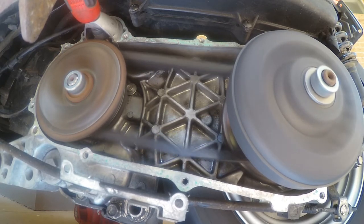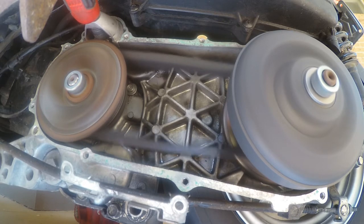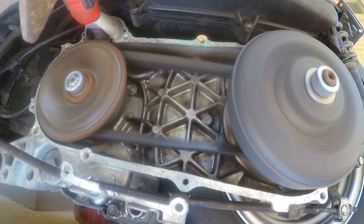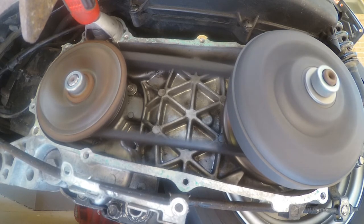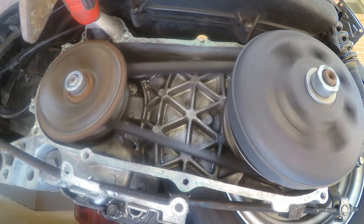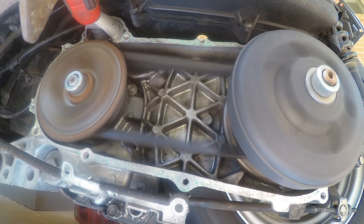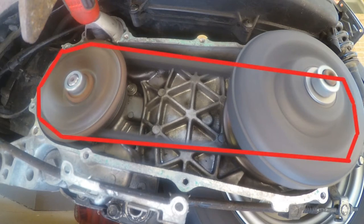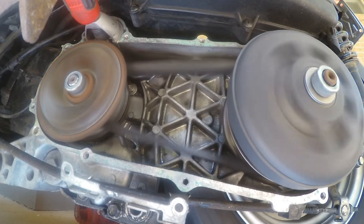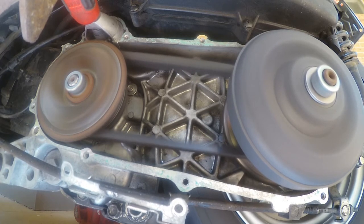Now as you're watching, keep in mind what I said about high and low gearing. You can see this system is doing what the name suggests — it's continuously varying the ratios between the front and rear pulleys. At lower engine speeds we've got a system that resembles low gearing. At high RPM we have a system that would work better for higher speeds, and you can see it smoothly transitioning between these changes. So let's dive in and check out how all these components actually work together so that this can occur.